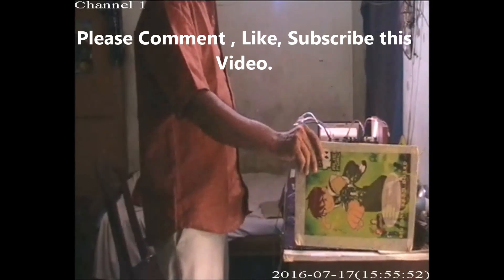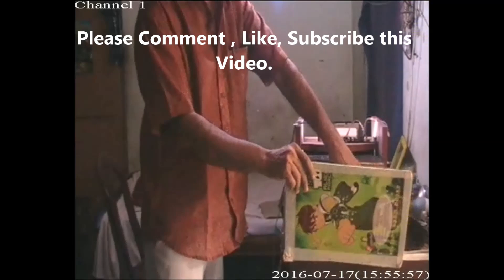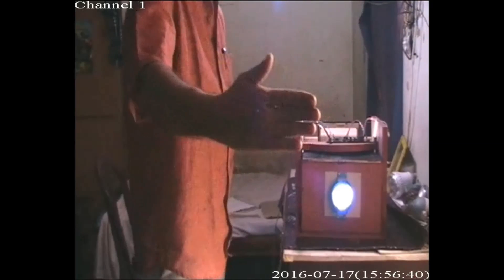Check that the lens is fixed in front of the panel. Again test with a white paper in front of the lens and focus the lens for sharpness of the picture. When the screen or wall is farther from the projector, the picture will be bigger, and you need to focus according to the distance between the wall and the projector.